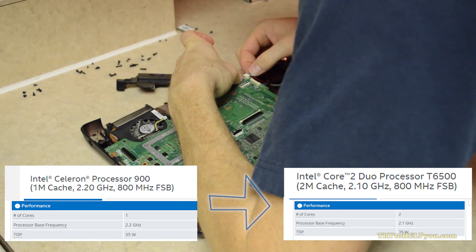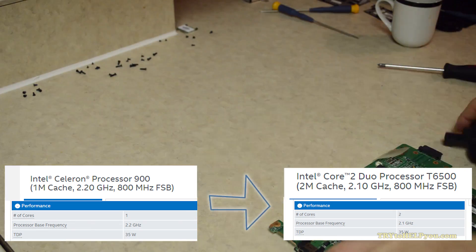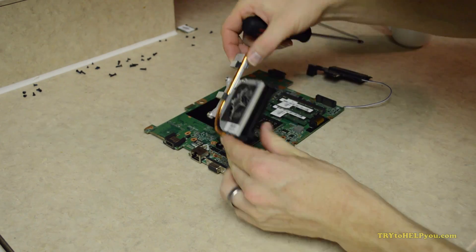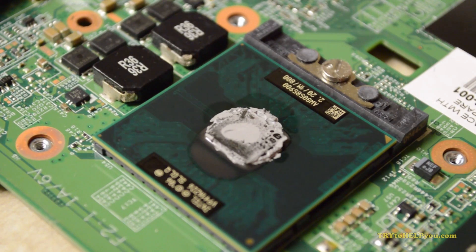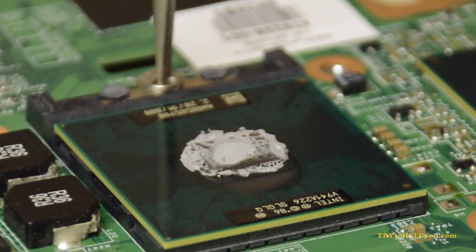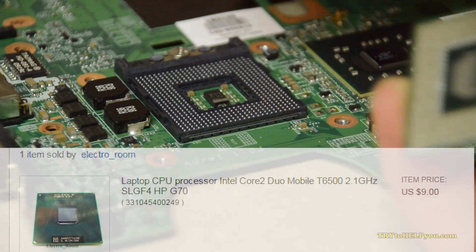You'll see here on the left and the right the difference — old to new. I'm getting pretty much just an extra core, which in the end made a huge difference. But once you've got the motherboard out, you just remove the heatsink, as you saw me do right there. And then take a look — there's the processor. There's the old one, and it's held in just by this little tension screw. Most processors will be like that, and you just pull it out. Look at that — that was pretty easy.